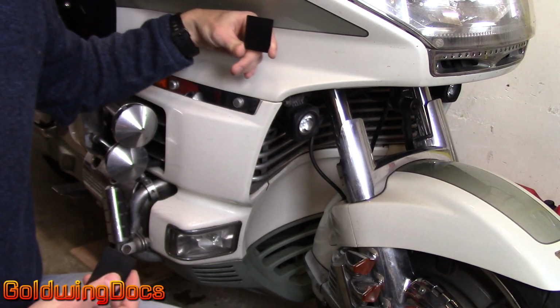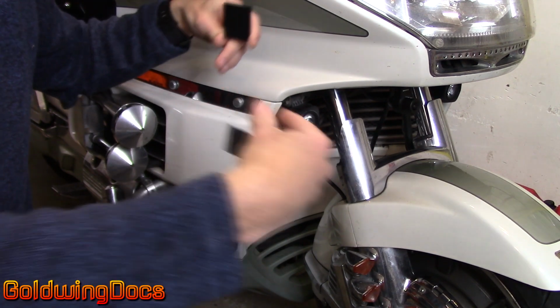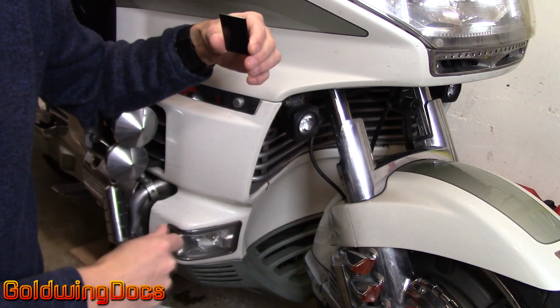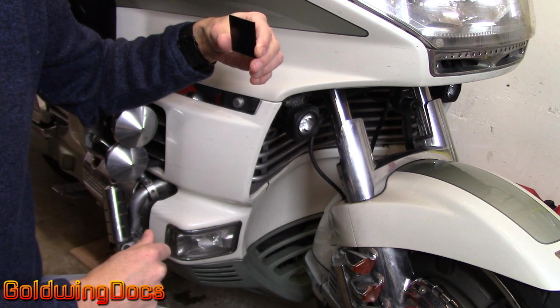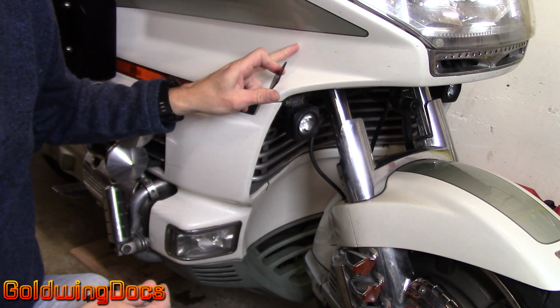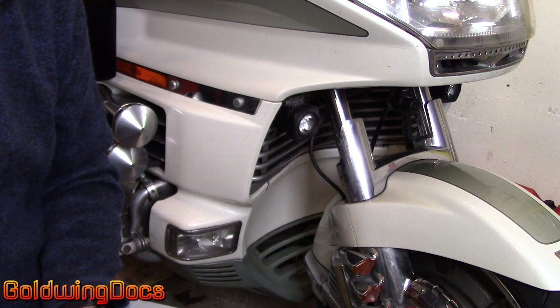I'll bond them using the glue that I'll show you in just a moment to the inside of the cracked piece. I'll push the cracked piece together, a little bit of solution on the inside, bond this to that panel, let it cure. Once it's cured, that crack is closed up so well that you can barely even see it and often doesn't even need to be repainted on the outside. And the repair is usually stronger than the piece was originally.